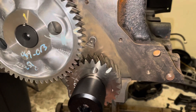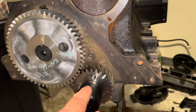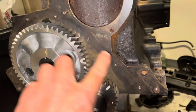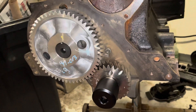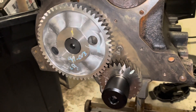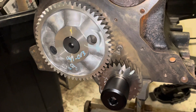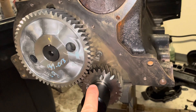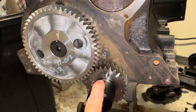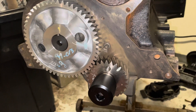What I try to do is get the seal concentric with the crankshaft before I tighten up these bolts, so that the cover is in the right position — basically the seal is sitting on the crank. In the previous series on the 3.0, I installed the front harmonic balancer, which was a major pain to install that device.